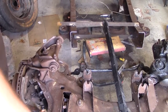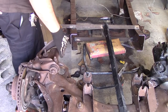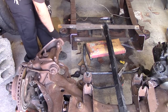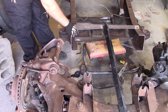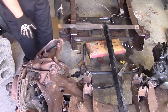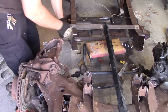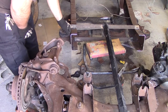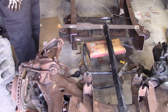So, instead of making bends to come in here, this last mount is even with the outside of the Bronco on each side. So, I could just drill like 2 holes, nut and bolt it inside. I'll put a plate in here, nut and bolt it, and I'll make gussets and weld everything in. Just box it, because that'll come up right here. So basically, all I need to do is have this piece. I need to make it bend a little for this mount, come down here, bend down. I can nut and bolt this piece, then weld it with a plate on the inside. That'll be perfect. It's like it was meant to be.